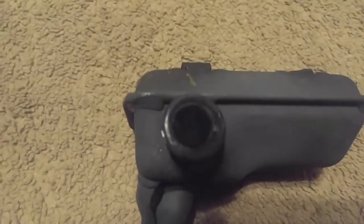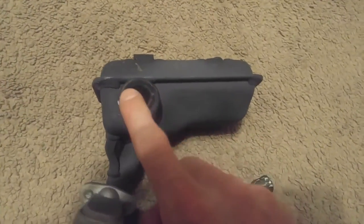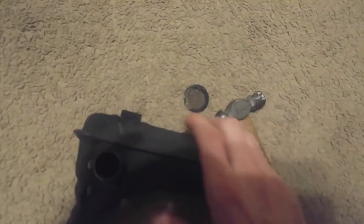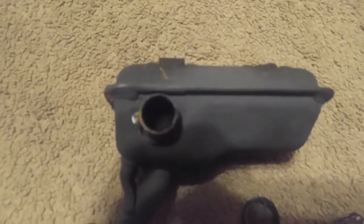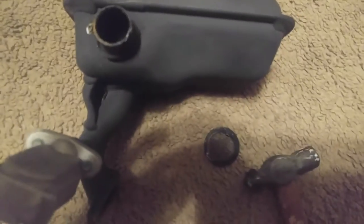What we got here is a little ball-peen hammer. You're gonna go ahead and take it to the very back of the lip there and just bust those little welds right off, and your screen should fall right off. It'll take a little bending of course, but you'll actually be less restricting your airflow and exhaust by removing that screen.